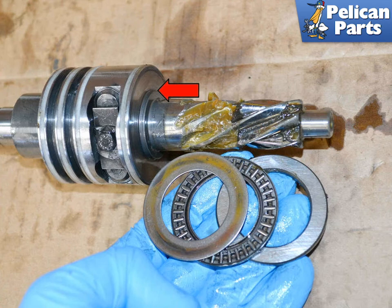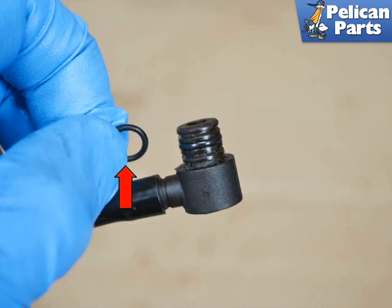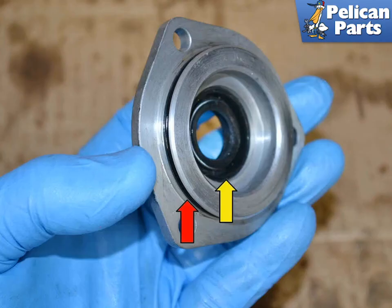I like to apply a little grease to the bearing and washer to hold everything in place. There are eight small o-rings that go in the banjo bolt fittings. The two smallest o-rings are for the breather tube fittings. Remove the old seal from the cap on the top of the housing and replace the seal in the same manner as the other one. Make sure the lip of the seal is facing in towards the pinion. Replace the rubber o-ring on the cap.